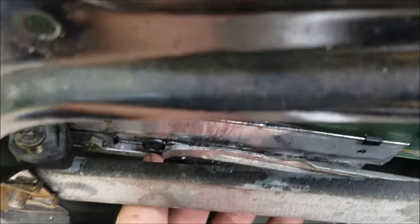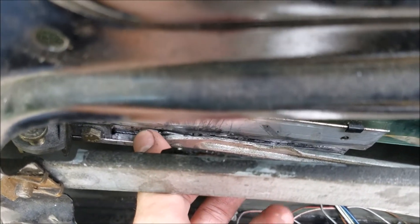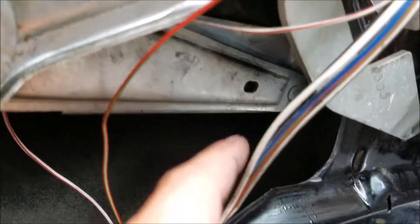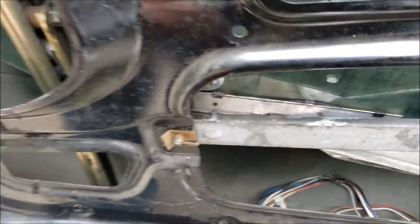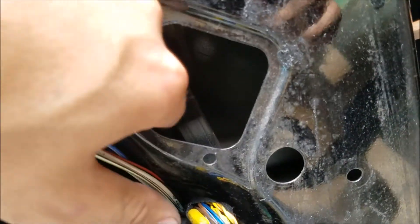When you're doing this, sometimes people have trouble with these regulators — maybe they're popping out after you put it in. Usually the culprit is you haven't put these ball joints in far enough into the slider and the clip on. If you've got the clip on, they shouldn't be able to break out unless they break the whole clip. Another thing — on this vehicle it was really quick because the window had not fallen out of the guide rail here, or in the front where the window's got to slide into. It had just fallen off the regulator, so this was actually a pretty quick job once I got the door panel off.